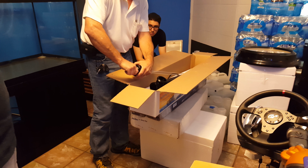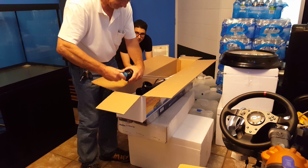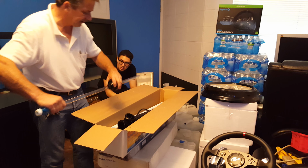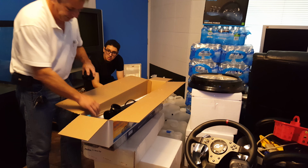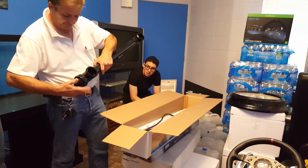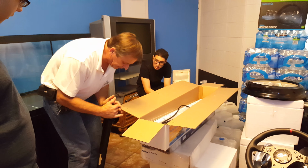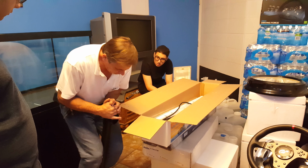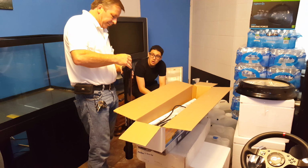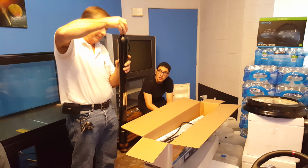So that's how you put the bulb in, which is completely isolated. And I understand that you don't want to touch the bulb with your hands, right? But this is the sleeve, so that's not a big deal. But I found if I just go with their assembly, I always have a leak, so I pull the sleeve out first, put that in, and get it nice and tight. The bulb sticks down too far or something, so then that won't tighten as far, or the sleeve sticks down too far, and then that won't tighten as far as it needs to.